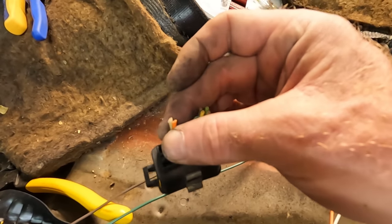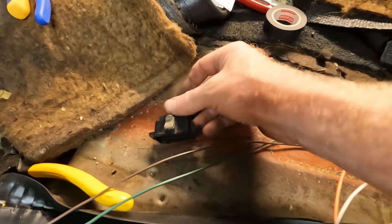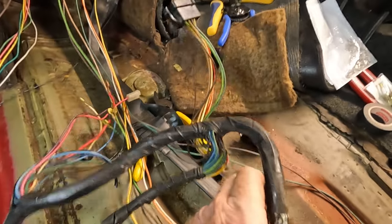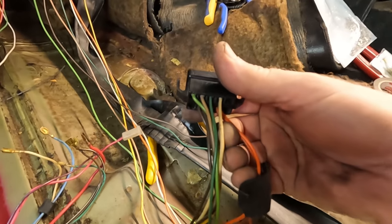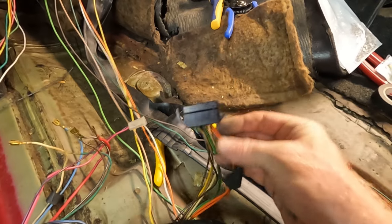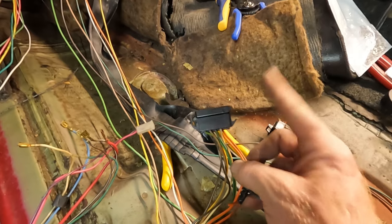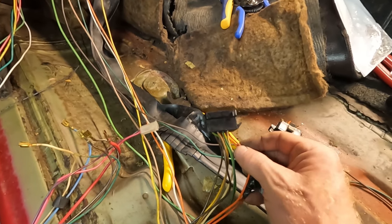What I did was — this connected to another piece on the original wiring harness. I took a look at the old one and noticed something interesting: the tan one comes in right there, and two orange come out. Which means they branched them off — one would go to the headlight switch, one would go to the door jamb. And that's what I need to do.